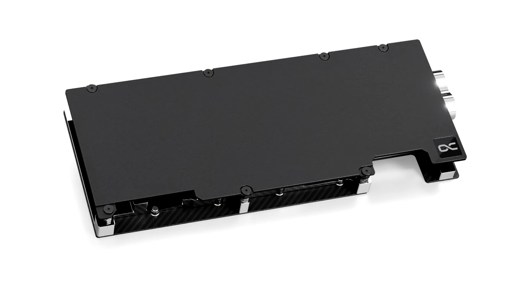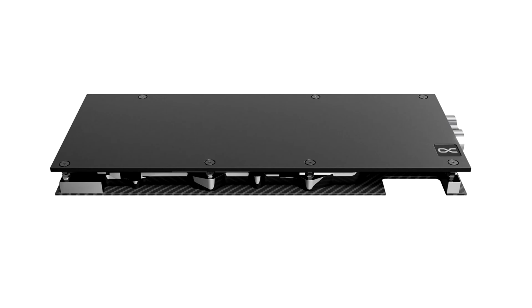Thanks to the compact design, only one slot is required for mounting the cooler in the server rack instead of 1.5 slots as before. Alphacool enters new territory here with the choice of materials. The cooler top is made of carbon with the result that the water cooler is significantly lighter compared to Alphacool's ice blocks with acetal or acrylic tops.